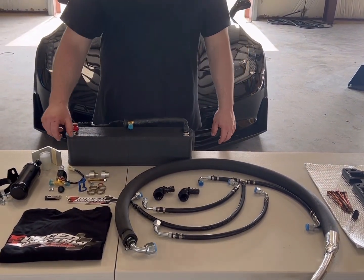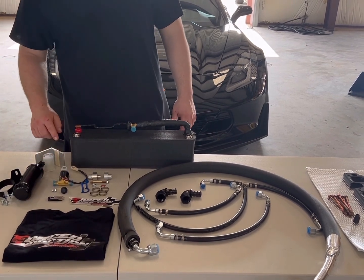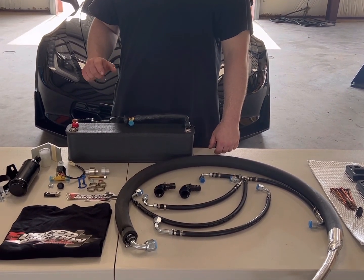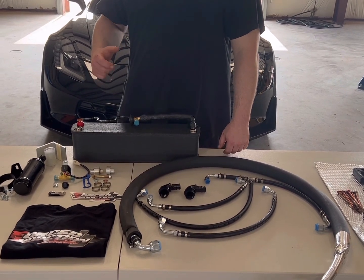Really easy to install. What we've got here is our solenoid and our switch. This solenoid allows you to cut off refrigerant flow to the cabin, so you can go into cabin and chiller mode or chiller only mode. In chiller only mode you'll use that in wintertime or when you're racing and you'll get colder.